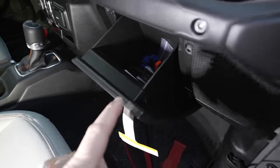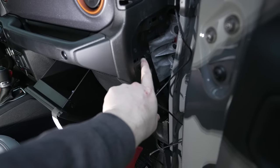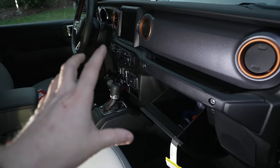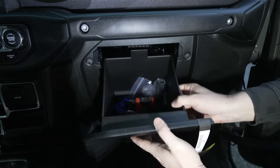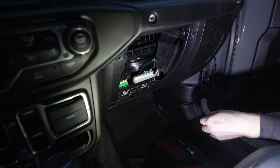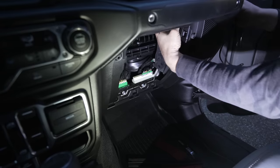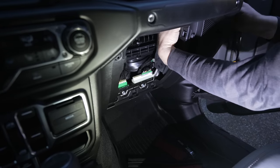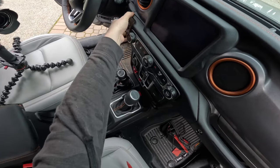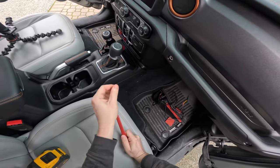I'm going to pull my glove box out because we need to route the wire down this top hole into behind the dash. It's really easy to release — just push this up here and this will release. We need to get this through the dash somehow, so put that through there until we feel it coming through. Now the next part is we've got to pop this panel off — this whole ignition panel — and then we can get access to a screw under here and swap our switches out.